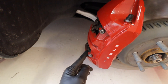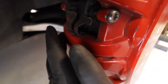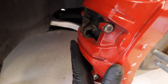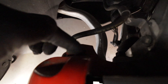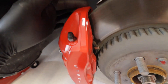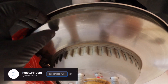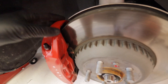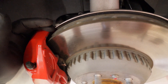This is a Brembo four piston monoblock. As you can see here you've got this strengthening bridge going over here. This is way bigger, way more solid than the long range, and this one is solid — it means that it is fastened here with two bolts behind here. This one doesn't move. On the long range it has these slider pins which it's mounted on, and when you use the brake the caliper is moving on those sliding pins. Here you've got free play in the rotor, so this is a two-part rotor and this rotor is sliding. This one is just fastened, it doesn't move at all, but the brake rotor is moving between — quite a difference.